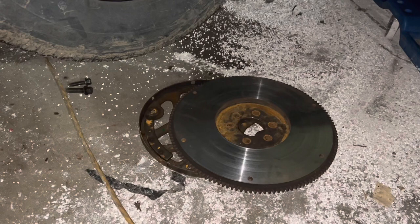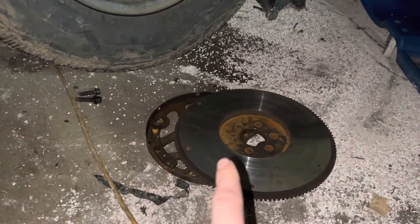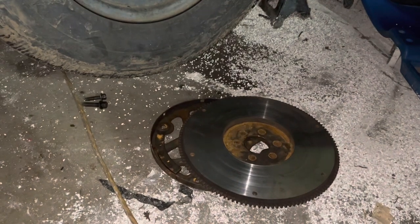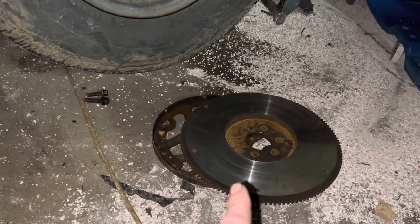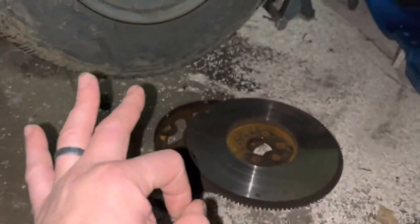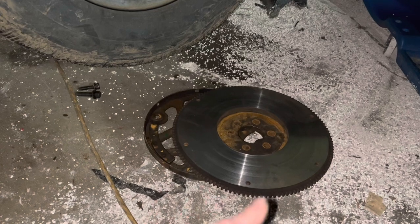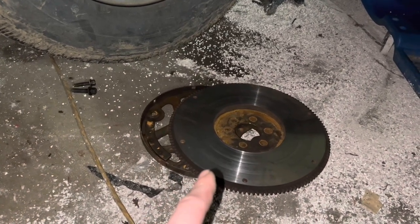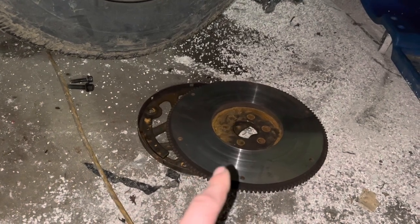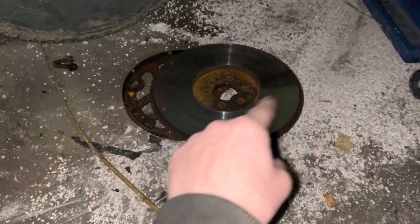I wanted to detail what I'm about to show you, just in case you — like just about everyone else in the universe — didn't see the first episode of the 3-Pedal Solution. This is a 318 neutral balance car flywheel. It fits a 10, 10.5 inch clutch. If you're unsure if you've got the right flywheel, check the diameter and count the teeth. I measured the diameter of the toothed ring to make sure it was the same as my torque converter, which it is. Larger truck flywheels will not work — they will not fit in the A833 bell housing and will not engage correctly with the starter. It's got to be a car flywheel from like the '70s with the right tooth count and the right diameter. 318 neutral balance — you cannot do this with a 360 external balance flywheel. An external balance flywheel will have a bunch of huge holes drilled in the back off to one side. Make sure you don't have that.